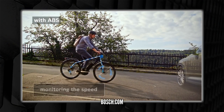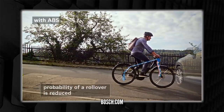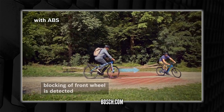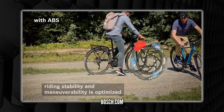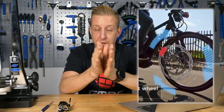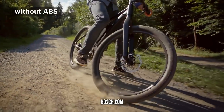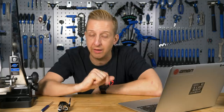I remembered someone at Eurobike telling me about this - it was Magura. Magura had been working with Bosch, basically making ABS brakes for e-bikes. The guy in the video is riding an urban commuter bike, but you get the point. It deals with the fact that you can't accidentally lock up a wheel, especially a front wheel, which would send you over the bars. There are lots of sensors on the bike - accelerometers and things - that figure out the rider's body weight and how aggressively you're braking. It does the same thing at the brake pads, enabling them to fluctuate faster than your human hand could. I think ABS could be really beneficial.